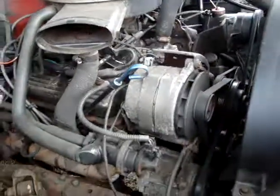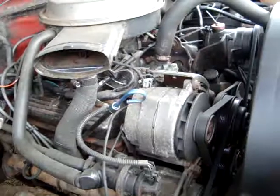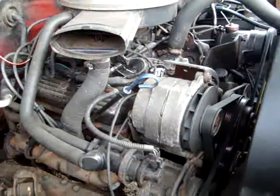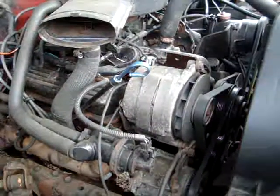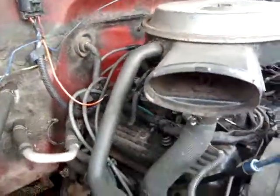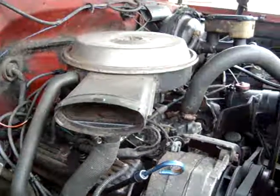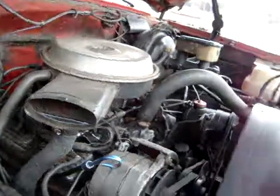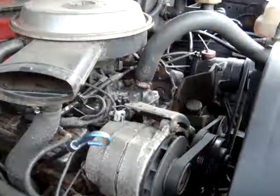It's a good motor. Now the only con I see to the 4.3 liter is it's not perfectly balanced by design. That's the biggest pro I see with the 292 inline. The other pro it has is being long stroked, what do they call it, an under-square engine. The big pros for the 4.3 liter is it's a small block, it's three-quarters of a small block. Everything that'll bolt on a 350, as far as accessories, will bolt onto a 4.3. It's not going to be any issue putting anything that I need to run in that truck on this truck.